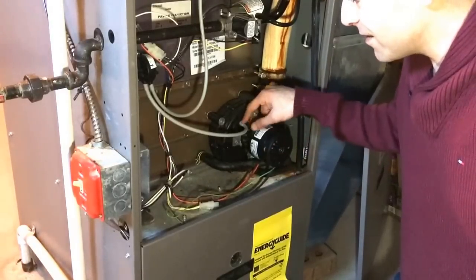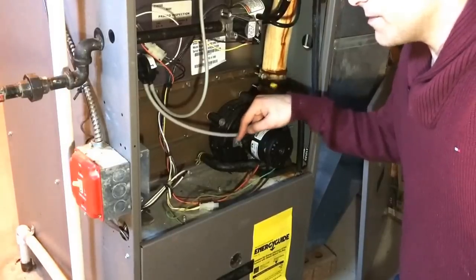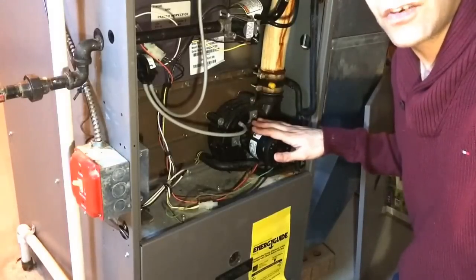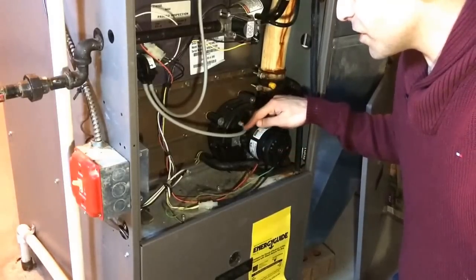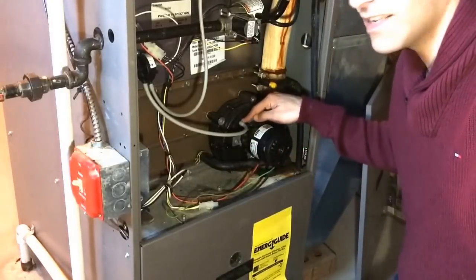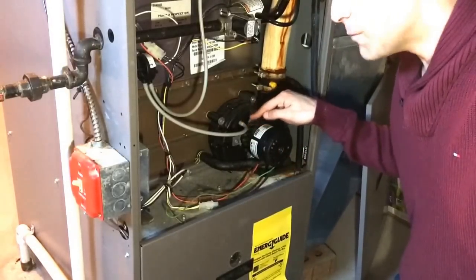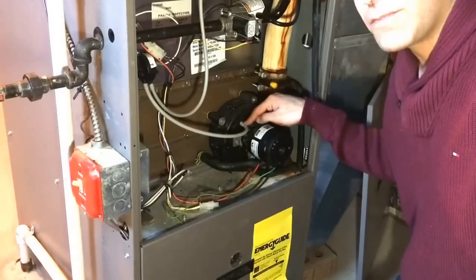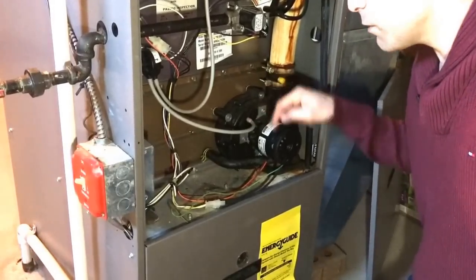What's going on is this little hose here should be blowing some air, putting some pressure on the pressure switch to let the pressure switch know that this thing is actually working. Well, there was no air coming through here, so I did a little diagnosis and found that this little port on the inside is clogged. In fact, there's something on the inside that's broken that had clogged this hole in the first place. So we ordered a new one and we're going to replace it.